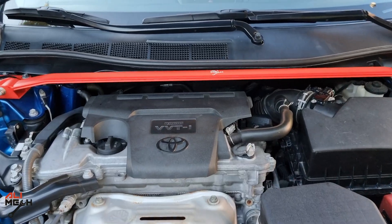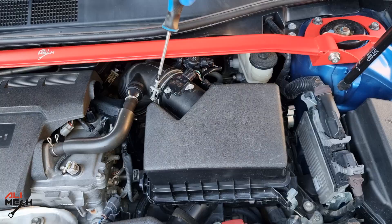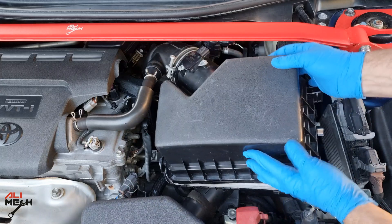The cleaning agent I will be using is Simple Green for the ultrasonic cleaner, then finishing with carb cleaner. Now that we know what we need, let's go ahead and remove the fuel injectors. We're gonna start from the filter box — take the Phillips screwdriver, loosen the clamp, and remove the mass airflow sensor wire harness.